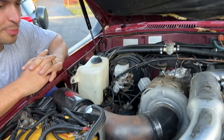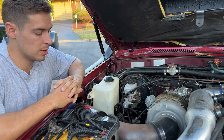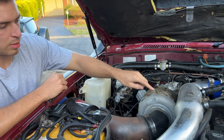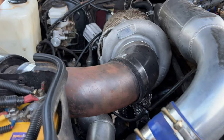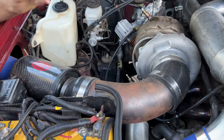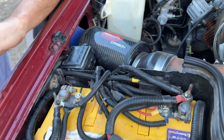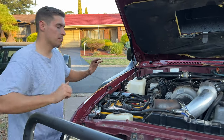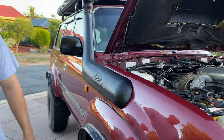It's not the cleanest of engine bays. I'm not too worried about cleanliness — it is a four-wheel drive and it's going to get used on dirty tracks. This is a 3582 turbo fed in by a stainless four-inch pipe. I've kept it on the cheap side for the airbox — it's just a SAS carbon pod filter that's sealed, which is fed in by a safari snorkel on the side here. I think it breathes pretty well.